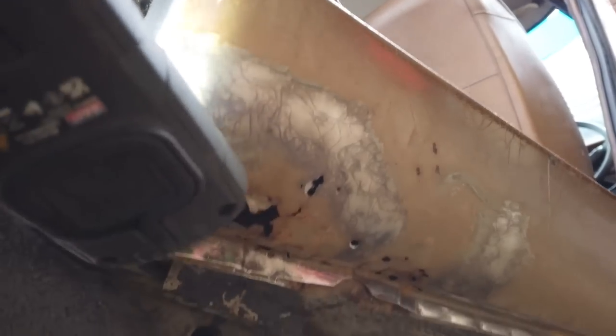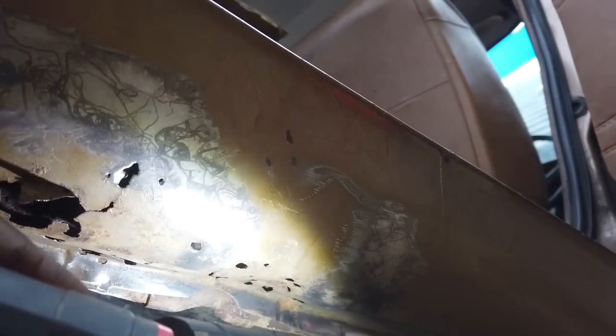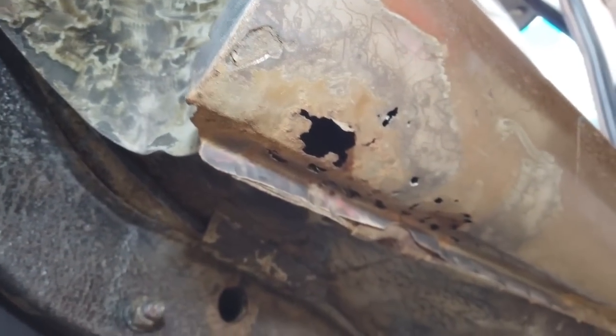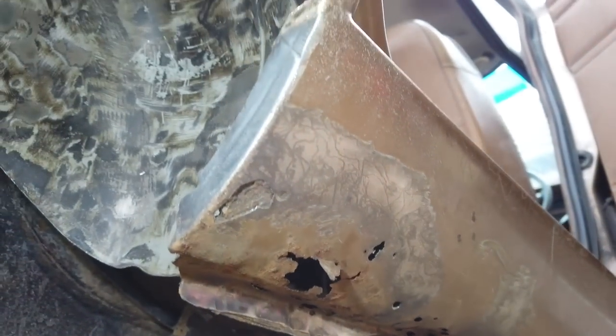That inner repair, which we do when this sill is extracted off. So we need to drill the spot welds on the bottom so it breaks away for the inner floor edge, staying clean. Slice across there, then break away the welds where it attaches to the inner tub, so you can get that piece extracted clean. So we need a clean extraction there. You can see the damage, folks. So we need to get busy.